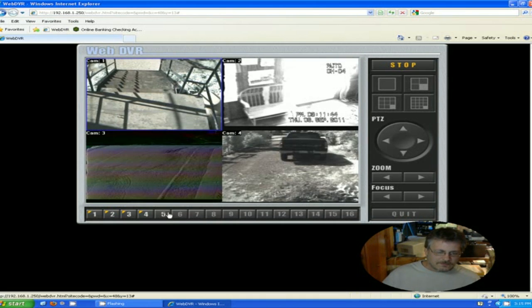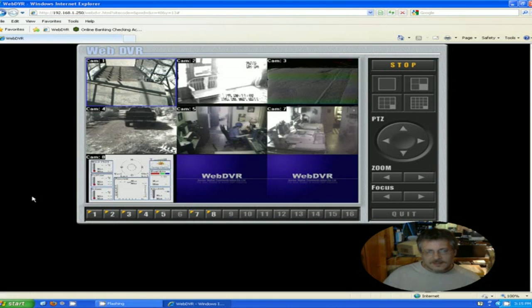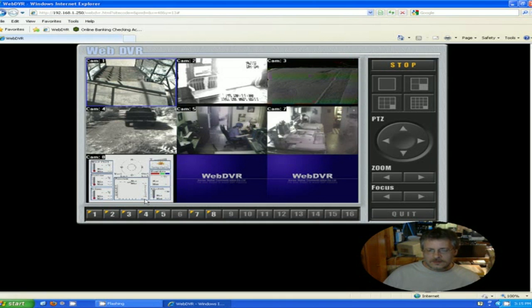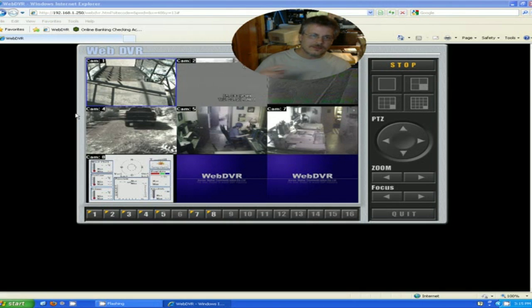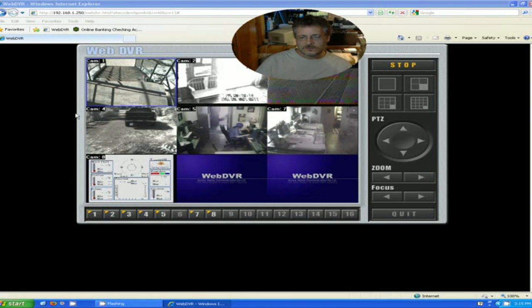So anyway, this concludes our video about our DVR system. If you want to set up your own, you can find the cards, find a used machine online, and you can put the whole thing together with the cameras and the whole bit. I would say for around $600 to $700, and it's going to be just as good, if not better, than anything that you bought pre-built. With my 40 gig hard drive, I'm currently getting about a week's worth, and what happens is it just rolls around and it deletes the oldest files, and then it replaces them with new stuff coming up.